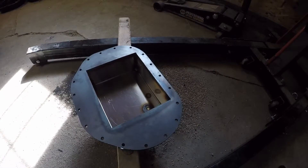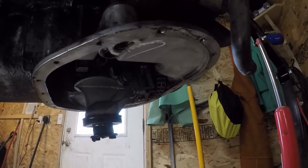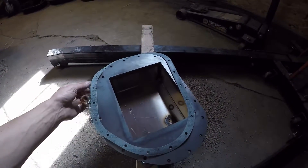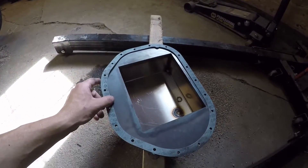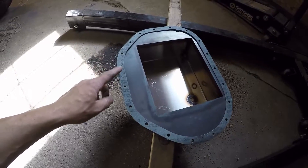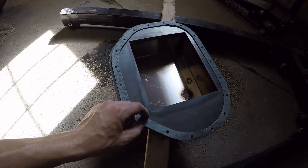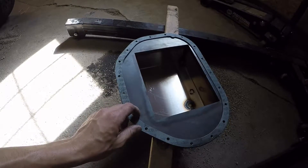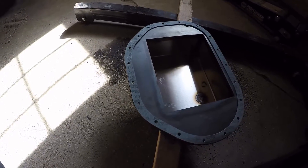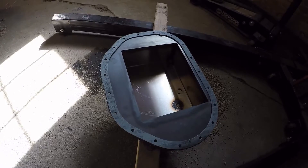Hello and welcome back. Now that we've gone ahead and cleaned the bottom side of our oil pan mating surface, we are going to be installing our oil pan. First thing you'll do is get your gasket out and get that into position. Some people will recommend that you take a very thin film of RTV and apply it to both sides to get it to hold in place and take up any small discontinuities in the mating surfaces — and that's okay. I typically like to apply them dry because it's less cleanup for me the next time I have to drop the oil pan. But we're going to get this positioned and mount it up and we'll show you what it looks like when we're done.